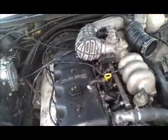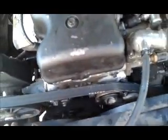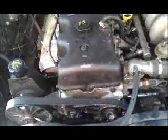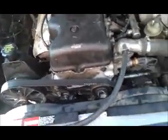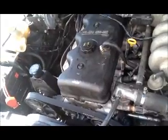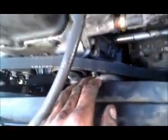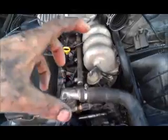This fucking heap of shit for today and yesterday. What happened is it sheared the dummy shaft, which I'll show you in a minute, which is basically the distributor drive shaft. Because when they made these engines over at Cam, they left the distributor mounted under the inlet manifold down in there, if you can see it, and they just used a small shaft with a gear on the end.